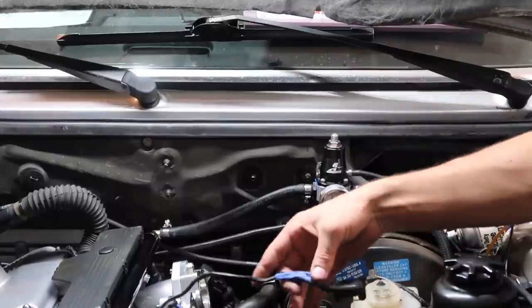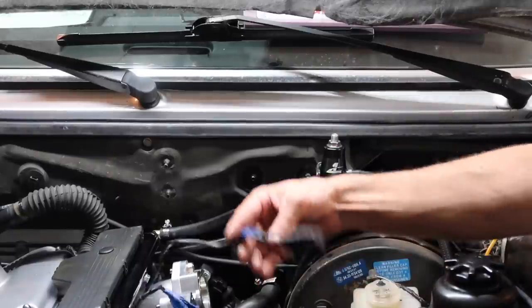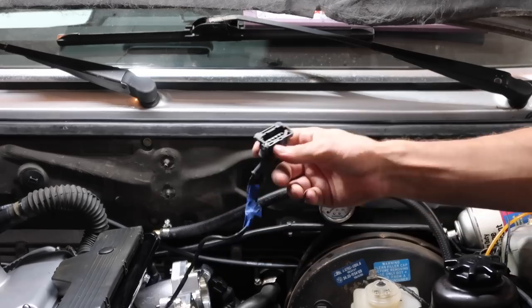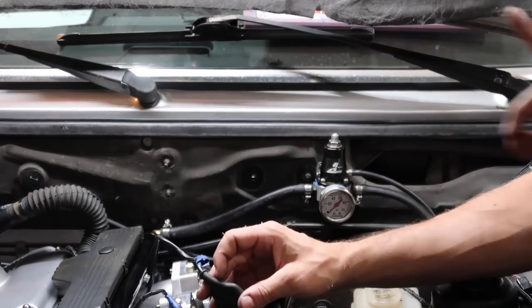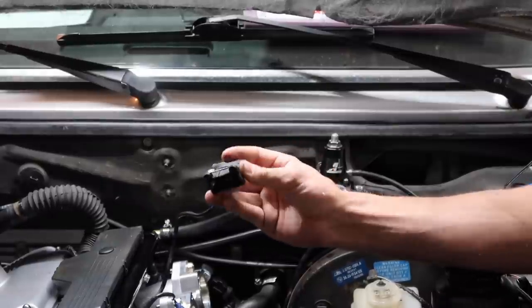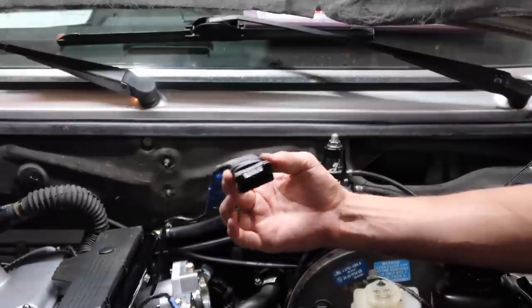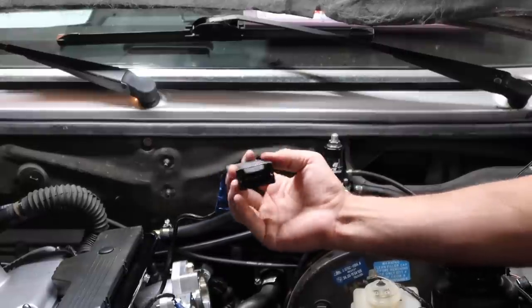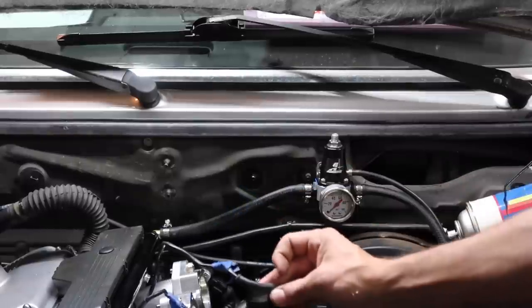One more thing, we gotta return to the wiring one last time. We have to get our IAT hooked up. So for IAT, what you have to do is, and this is the coolest thing ever, the factory AFM wiring contains an IAT sensor within it. So what we have to do is cut off this connector, cut and splice, and we're gonna get this AFM connector